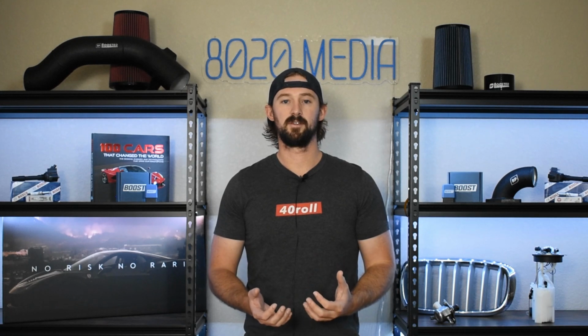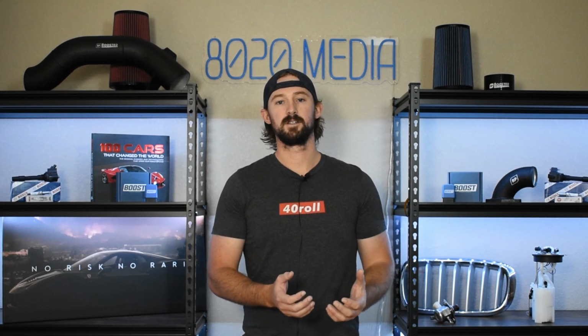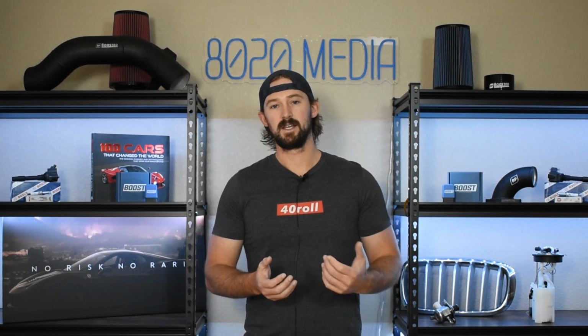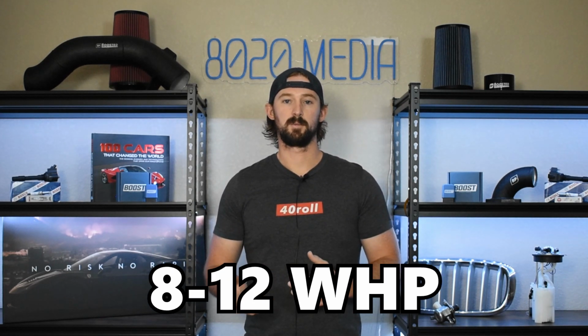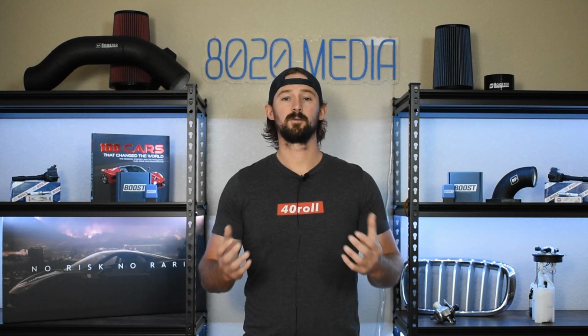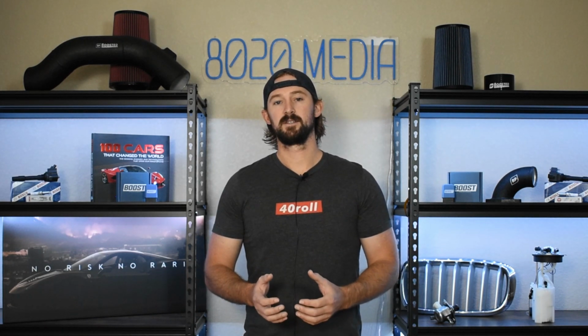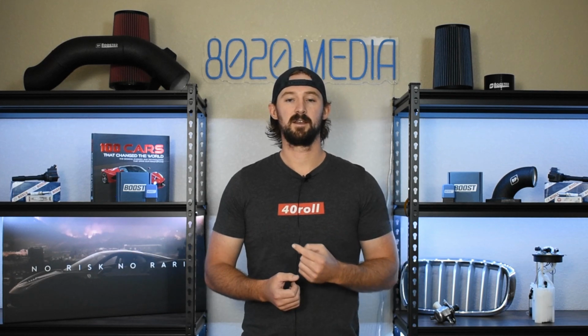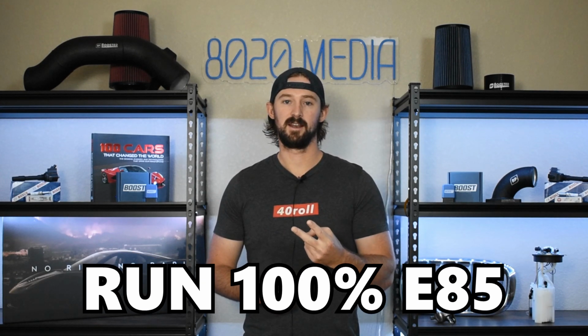Saving the best for last is tuning. The reason I wanted to talk about this last is because tuning on its own isn't going to be a huge power driver for these engines. You'll likely see 8 to 12 wheel horsepower and maybe 10 to 15 wheel torque from tuning on an otherwise completely stock vehicle, but tuning is extremely important because we need it to fully eliminate the torque dip and we need it to run 100% E85 fueling.